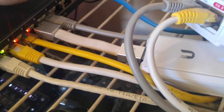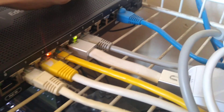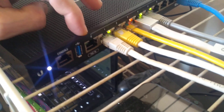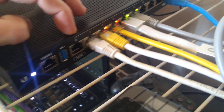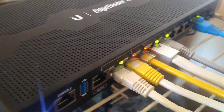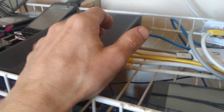It's definitely not plug and play. I didn't even use the Cloud Key to hook it up because I didn't have the internet. So when I first tried it — I don't know if the Cloud Key would have actually worked if I had it hooked up that way. You've got to hook it up here for a static IP, give your computer a static IP, set this up — and that's pretty much it, a couple other things. Now it's pretty easy — I can reset all these devices, the Cloud Key, the AP, and have them all back up and running in 5–10 minutes.